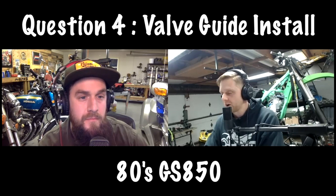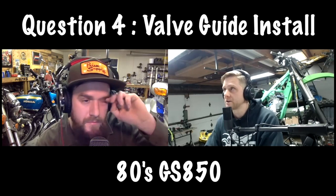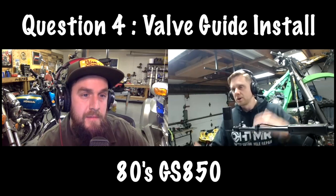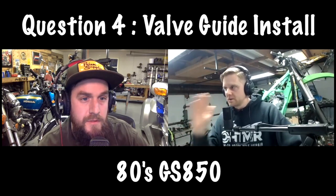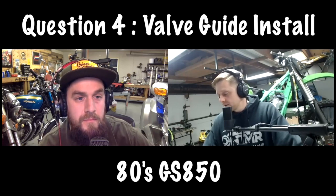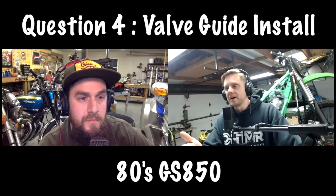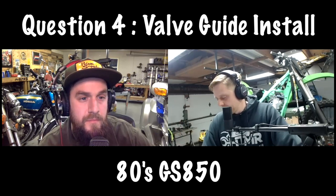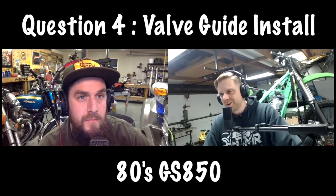So if you do not have the cutters, then I don't see how you can do this job yourself, because now your valve is going to be closing on a seat that is not concentric to your new guide. I've watched a machinist remove and install guides and ream them and do a valve job, but I've never seen it done manually. I know you talked about it. Maybe you can add to this. But I just don't see how you can ream a straight hole with a drill.